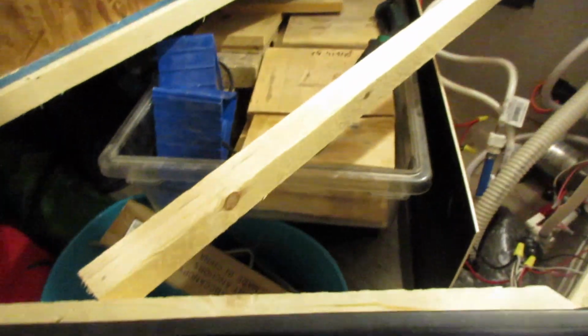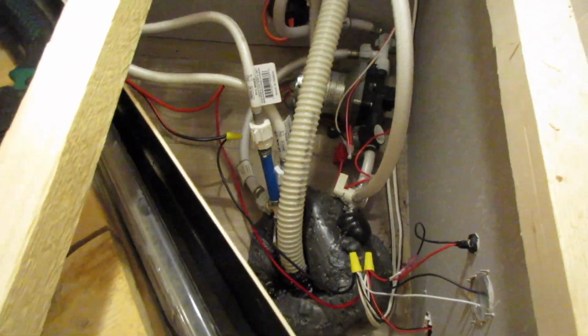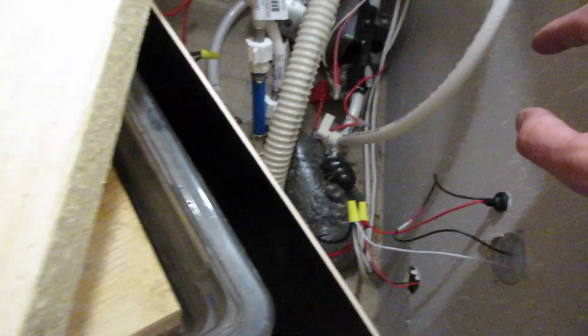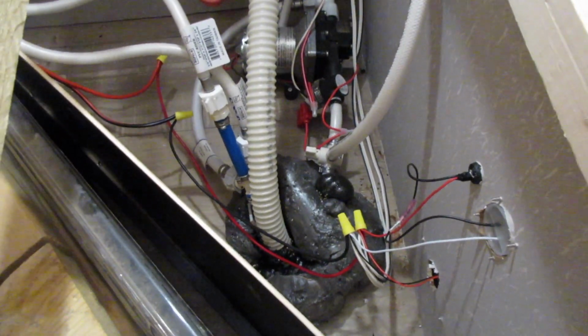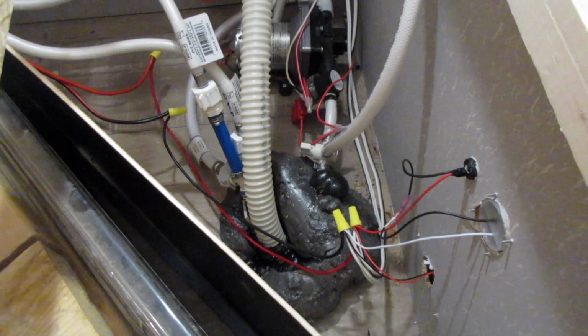So let's lift that up, and there is our water pump. This is a new enough camper that it already is prepped for winterization. So I've got this siphon hose right here that I can put in my antifreeze, and then all I have to do, sorry I'm a little out of breath crawling out of that compartment and being congested, is turn this valve right here up, and then we will be sucking out of the bucket that my antifreeze is in, and no longer sucking out of the freshwater tank.